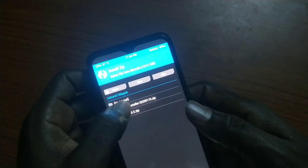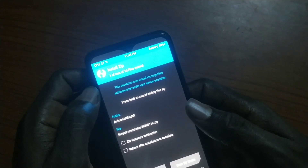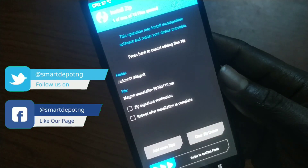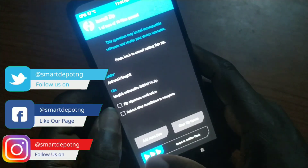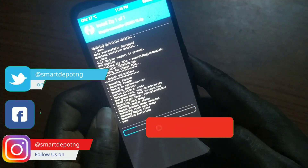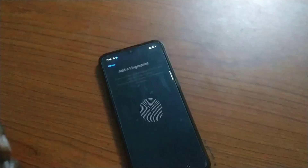So these are some of the things I did trying to deal with it. I decided to unroot, because there is a Magisk uninstaller ZIP you can flash if you want to unroot. Flashing that means I'm going to return back from custom recovery to stock recovery — but that still didn't work.